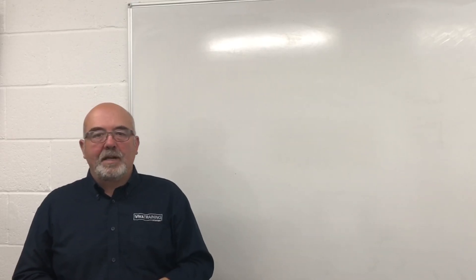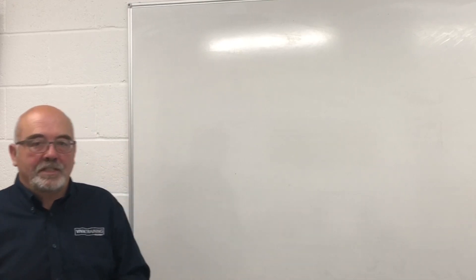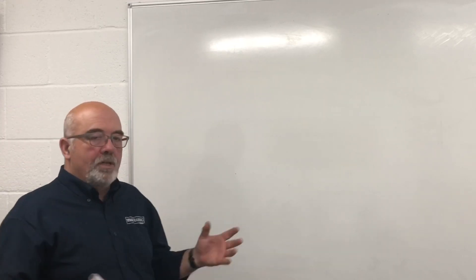My name is Russ. I've been training in the gas industry for over 20 years and in the industry itself for well over 40 years. We're going to try to show you today liquid expansion controls. It's something that catches people out mainly because quite often they mistake liquid expansion for thermoelectric. The probe itself is quite similar to look at — the actual bit that senses the heat is quite similar.